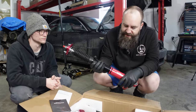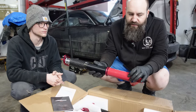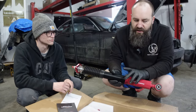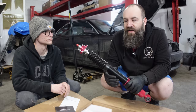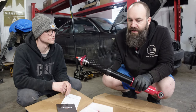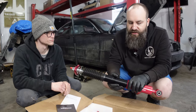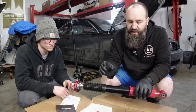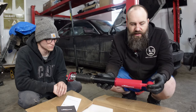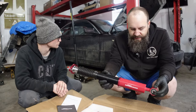What's really nice is each one has adjustability for the strut itself to lower right into the body of the coilover. One of the biggest issues with lowering on stock struts is the strut becomes pre-compressed, reducing the overall life of the system. With these, if you're lowering two inches you simply shorten the strut two inches. So we'll determine the lowering we want, take the factory length of the strut, lower it by that amount, and go from there.